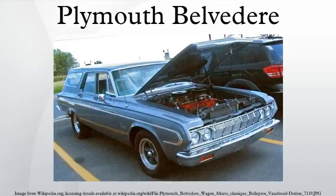Engines note: there are some discrepancies in this section referring to the term Hemi. The 340 engines were not Hemis, and the Hemi was first put into production and performance use as early as 1951, not in the late '60s as the last paragraph suggests. The old-style A engines — 277, 303, and 318 — were manufactured from 1955 to 1966.